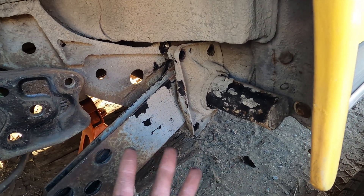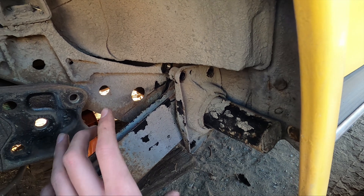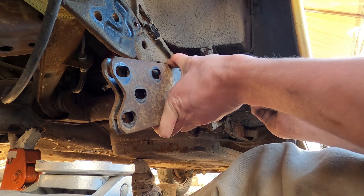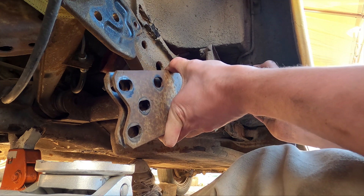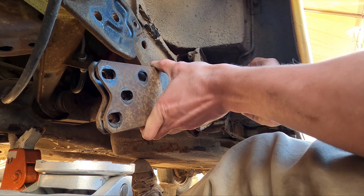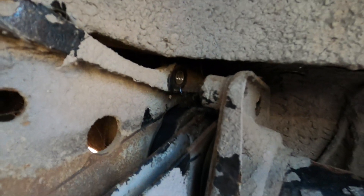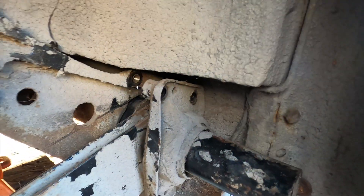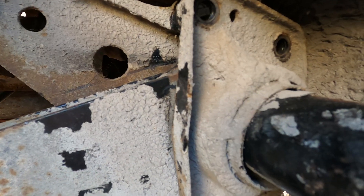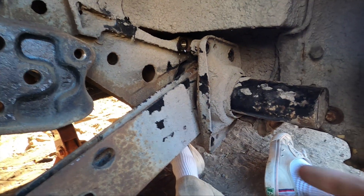Be careful — you don't want to just pull it off because then you'll have no idea where everything is set. Just take your time, slowly wiggle it, then rotate it down and keep putting pressure in. As soon as it hits that next spline it's just going to pop back in. I can feel it's popped off that outer one, so I'm just going to carefully try and rotate it to get it back on. One thing you'll notice too is that this bushing has a little bump on it — if you rotate it and pop it back on and that thing goes in perfectly, you probably haven't changed the ride height at all. So I'm going to try and pop it off again and just take my time and get it down a spline.